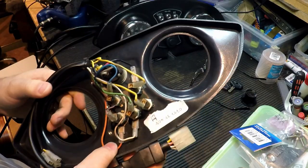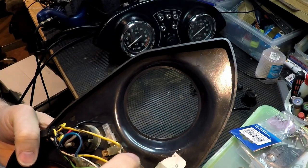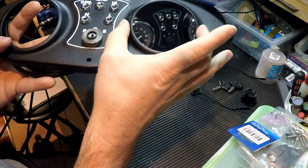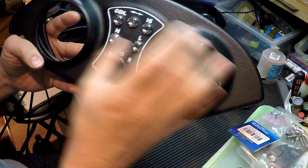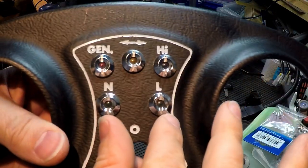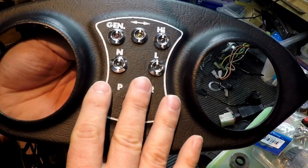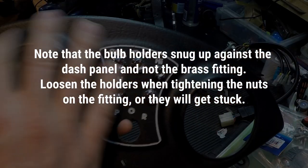The other nice thing about these original dashes is that this cutout here in the middle is in the middle. The remanufactured ones — just be aware that these are typically quite a bit off-center, and when you look at your instruments, you may find they overhang the edge on one side and give you a big bump on the other side. Whereas these are quite nicely centered, as is my old dash as well. I said just before that I'd tightened mine up so they just ended up wherever they happened to tighten. In the factory, what they've done is been careful about it, positioned everything, put these together first, then tightened it up so they would end up straight. So that's some little bit of attention to detail.